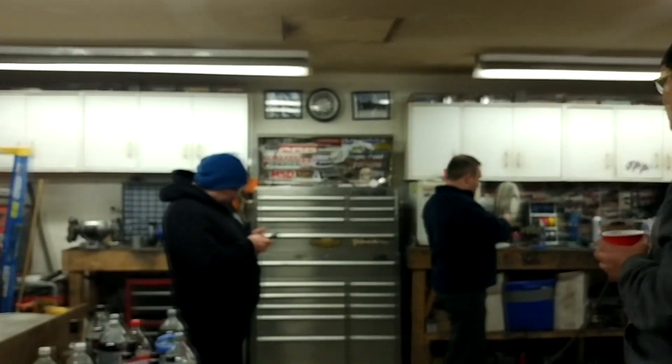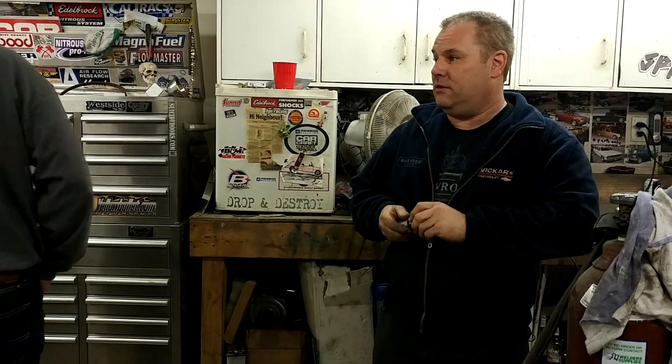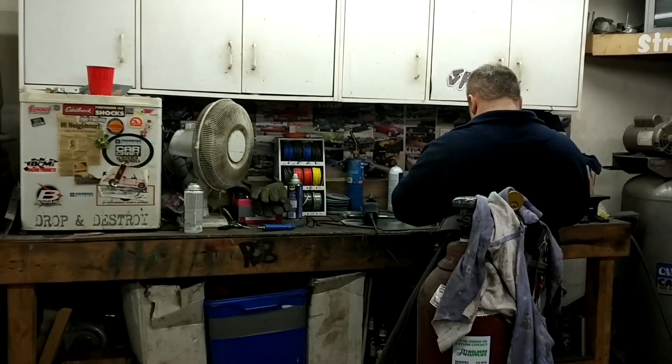I was thinking about Clayton and his torque wrench theory. He's just one of those guys who thinks because it's newer, because it's a new style, it's better. But in reality, it does the same thing that a bendy does - it just makes a clicking sound which makes you feel better. For those subscribed to Motor Trend On Demand, you can see David Freiberger using a bendy on the motor for the Crusher Camaro. Most people should use bendys, and you want to know why? Because most people leave their torque wrench set on the last setting they used and they mess up the calibration within the first year of owning it.